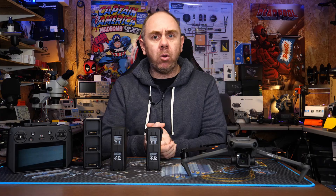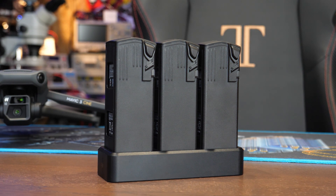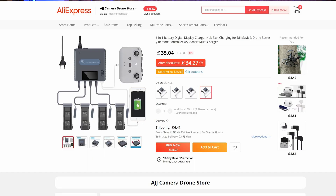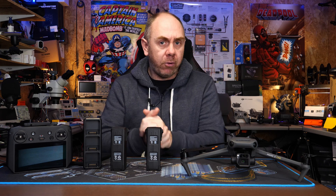One important thing to note is to charge the batteries on the drone you need to use the hardwired USB-C cable and not the USB-A port, because while both will charge the battery, it is the USB-C hardwired cable that has that 65W output and will charge the battery in about an hour and a half. The DJI hub, available with the fly more or cine pack, charges batteries sequentially. We are also starting to see third-party chargers that will allow you to charge up to four batteries at the same time, which is quicker than using the hub.